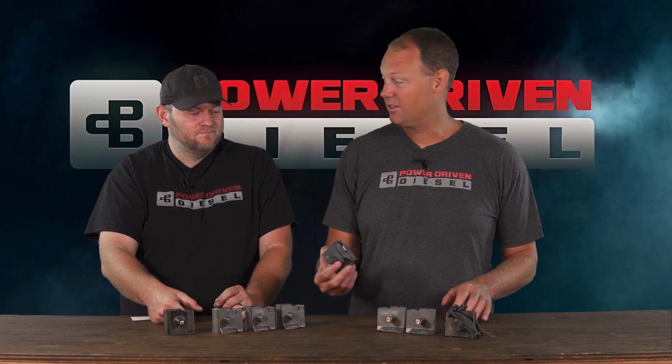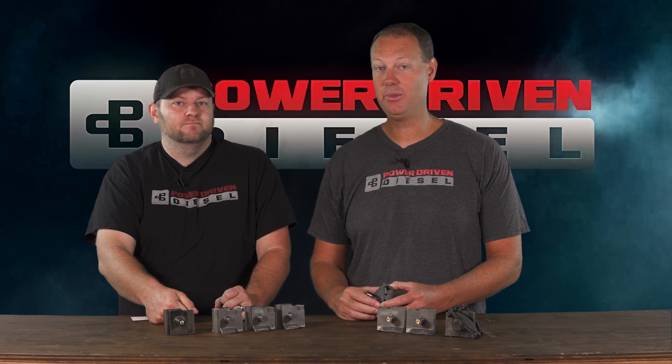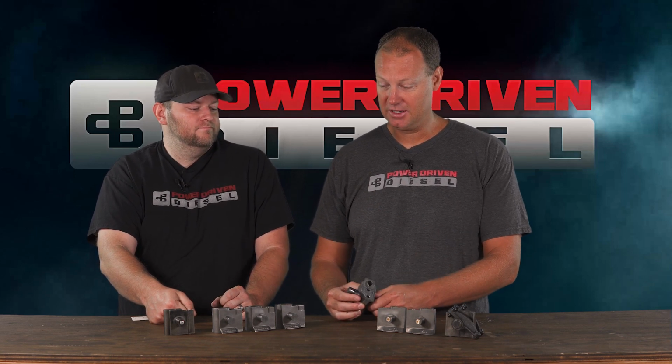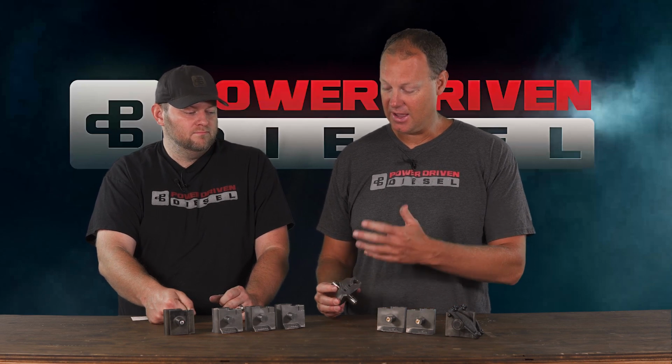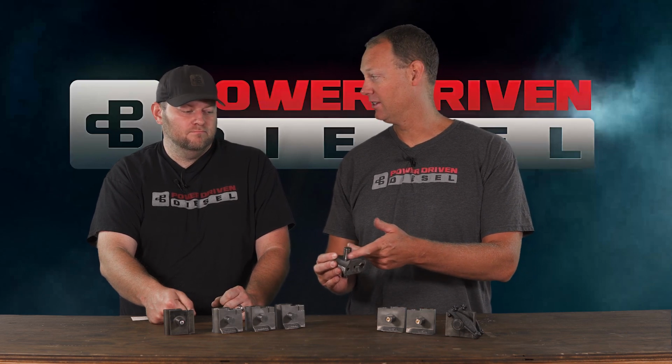One of the upgrades also is the pin. Let's talk about the pin and what we've done, because we do have problems with oil in today's world. If you buy our Power Driven oil, this is much less likely to happen because ours is jacked up with anti-wear. But even still, we like to have extra oiling anywhere we can, because as the spring pressures get really high, you have a lot of pressure on this guy here.